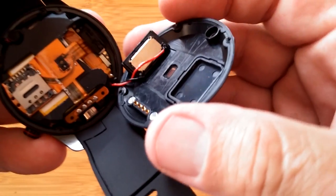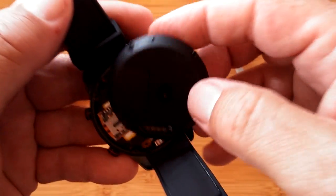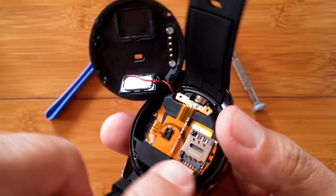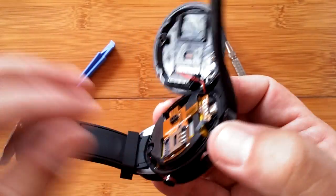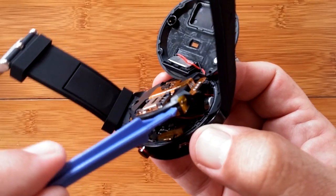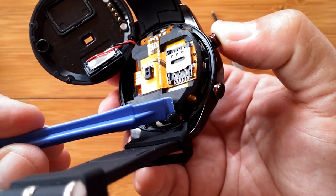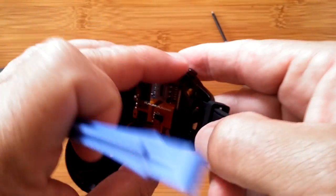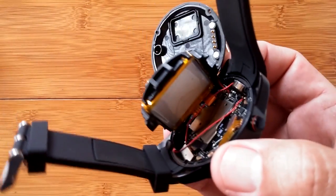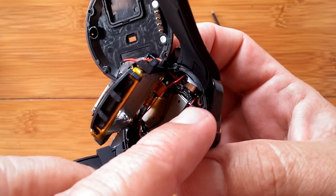Let's go deeper. You can see that these wires are soldered right here — there's no connector to take them off. Judging by the holes, that's probably the speaker. It may have a connection down deeper but we've got to get there first, so we have a lot of intertwining wires that loop around. With a plastic tool we're going to get in here and lift up the center module. The battery itself is here — there's a wire going this way connected to a little thing right here. We have to lift and move it to release that before the module is free.